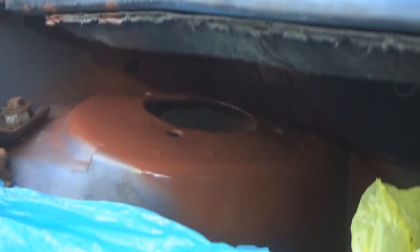And then starting with the passenger side, I went ahead and sprayed some Rust-Oleum Rusty Metal Primer on the top and on the bottom of the strut tower. I particularly bought the Rusty Metal one because there was probably still going to be rust there, and I was right, we didn't get it all off. But that is supposed to stop the rust from spreading. It's oil-based, and obviously it's going to allow the paint to adhere to the surface also.